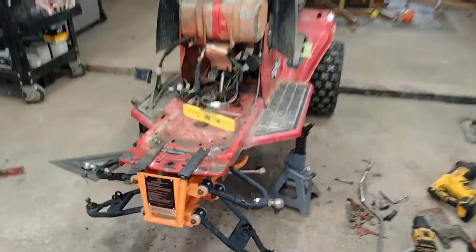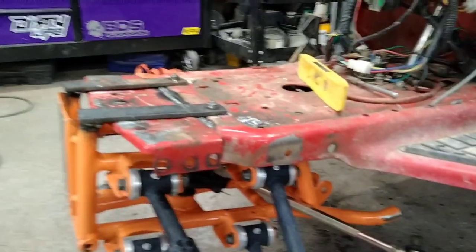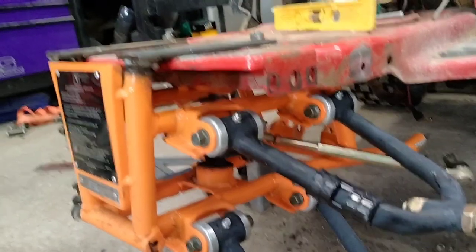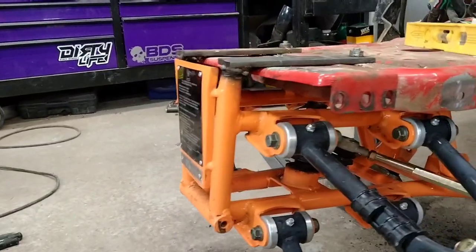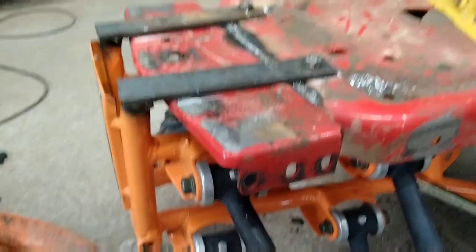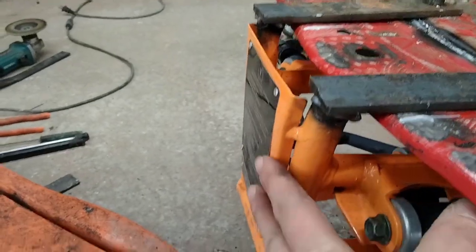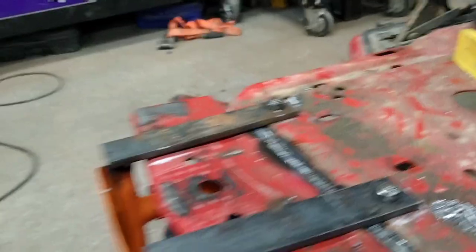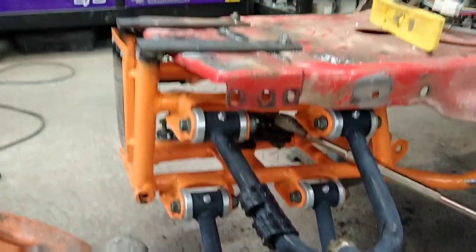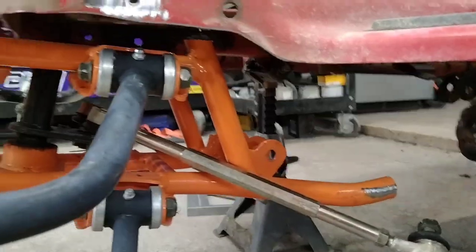Well, there you have it folks — we gutted the old front end this morning, and here it is on the ground. There wasn't a lot to film in the process of getting this on here. I already had this chopped off of a parts four-wheeler, and we just figured out we're going to try to mod this in here as crude as possible. We got two pieces of flat strap — this used to be the axle guide, we just flipped that up and welded that on there nice and solid.